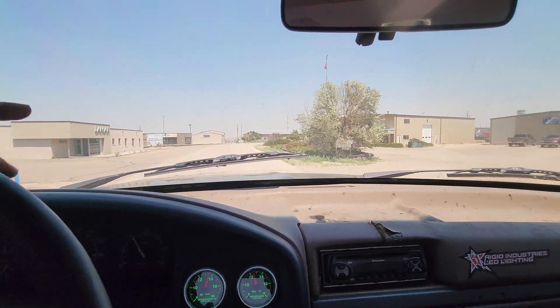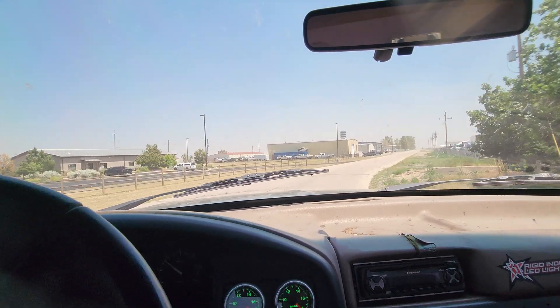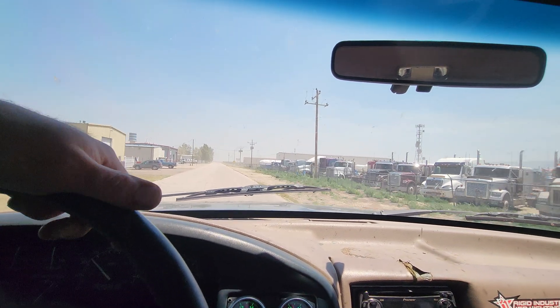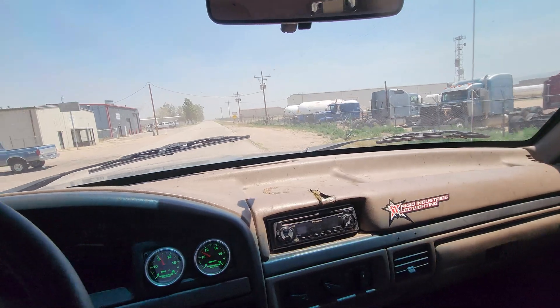You can see nice air-fuel curves. We'll get a little bit of variation between the two cylinder banks, but anytime you're standing on the gas they even ride out, which is pretty cool. We'll get this guy's paperwork done, check over a few more things, make sure all the exhaust hanger bolts are tight, and then she'll be heading out of here today.